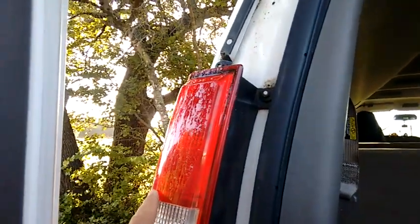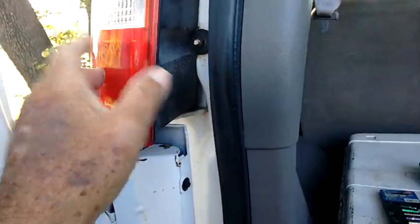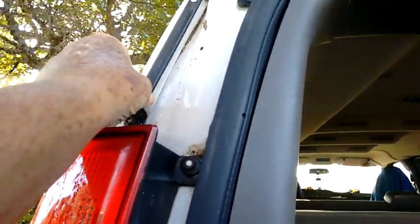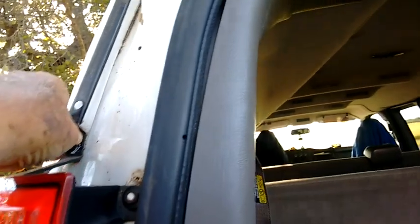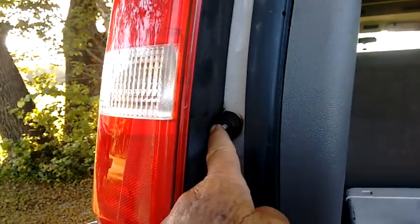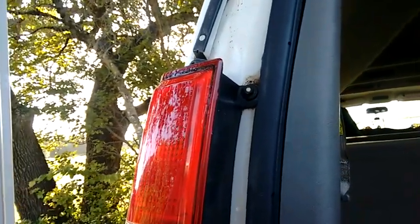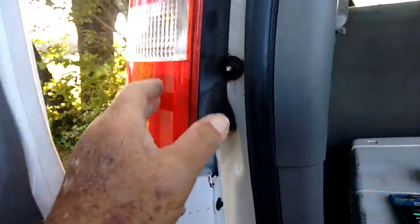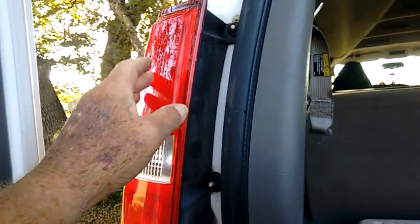Sitting up there, a little bit hard to start these. Now that top bolt's a little bit loose, but down here on the bottom there's a little stud sticking up — you need to be sure that this is sitting in there. You don't want to loosen that top nut because if you do, this is slotted and you'll get it all out of catawampus — it'll be too hard to put back together. If you leave it like that, wherever this falls up here, that's where it's got to go. These are pretty much limited; they don't have much movement at all when tightened down. I'm gonna go ahead and tighten them down, then install that top part. When you get it plugged in, check it again — make sure you got the bulb in the right socket. Up here is where the signal light is and the one that burned out, and that's also the one that flashes when you use your key fob.